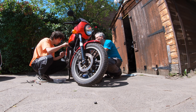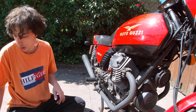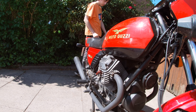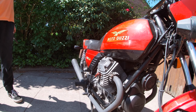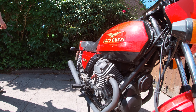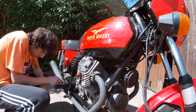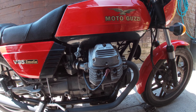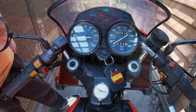So how was that as the first service you've done on your own bike? It was pretty easy wasn't it. The fantastic thing about Guzzis is unlike even a BSA or something — to check the valves you don't really even need the tank off. It's even easier if you take the tank off, but there's no need. It's just that little cover and there's the valve — it's a matter of minutes. On my own it would have been twice as quick; I'd say 20 minutes to half an hour and you're done. Finding top dead center is actually not that difficult — it's quite easy. Job done. Well, I hope you found that useful — if you did don't forget to like and subscribe, and thank you very much for watching.